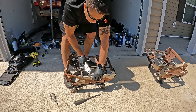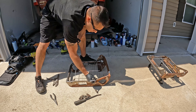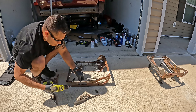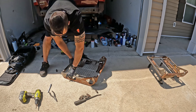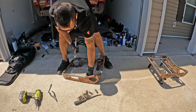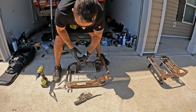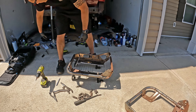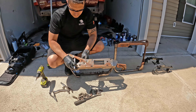The driver's seat falling apart was due to old age, but it was also due to a design issue — since the support springs are lower than the outer edge of the seat, this allows the cushion to rest entirely on a narrow strip of metal and wear down over time. I decided to add a couple of springs borrowed from the spare seat and move the springs up higher by drilling new retaining holes, to prevent the extra wear on the new cushion in the future.